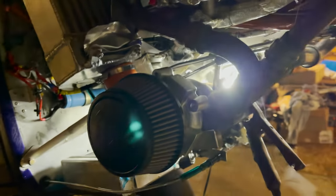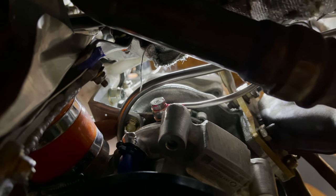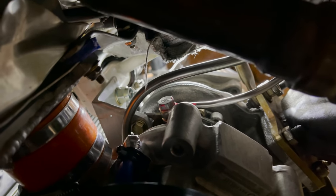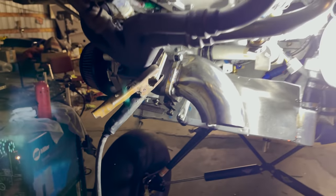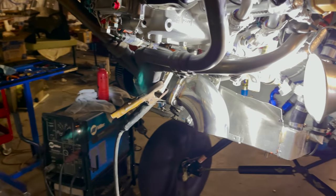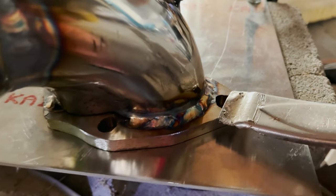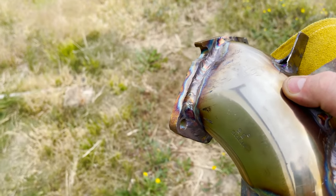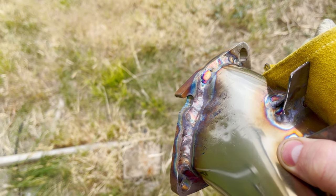I got the turbo all mounted up. Oil lines are done. Everything but the exhaust is done and it came out pretty good. That bracket was a little bit of a pain to get the bolt in. I only have so much area to work with coming off that V-band clamp. So I got the TIG out. I'm starting to put the dump pipe together — shaping that was a pain but I got it oriented about right. I'm going to tack it in one more spot and then pull it off and actually start welding things up for real.